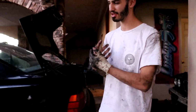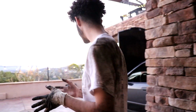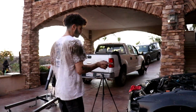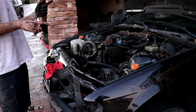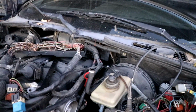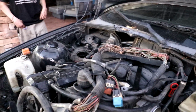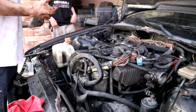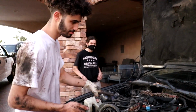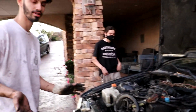Exhaust came out, heat shielding came out, and the cross member for the transmission came out. So now, I'm pretty sure that's everything at the bottom. I mean, underneath the car, you know? Power steering is disconnected. Heater hoses are still connected, which I'm hoping once we get a little bit of weight up off of the chassis, I can disconnect pretty easy. And manifolds are disconnected, vacuum lines are disconnected. I'm pretty sure we're good.